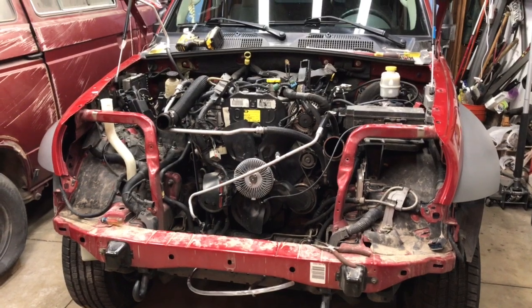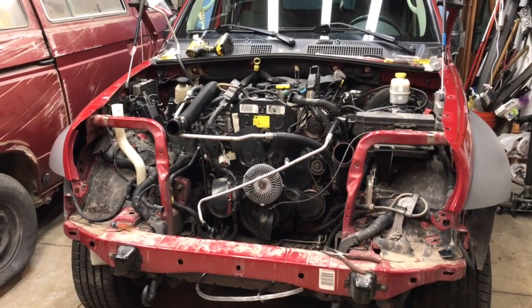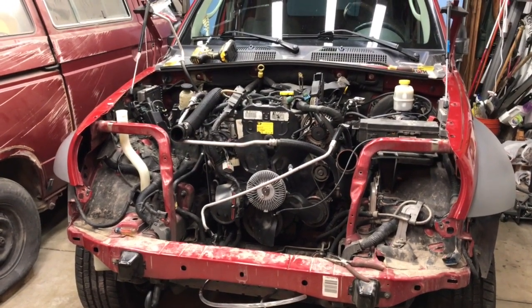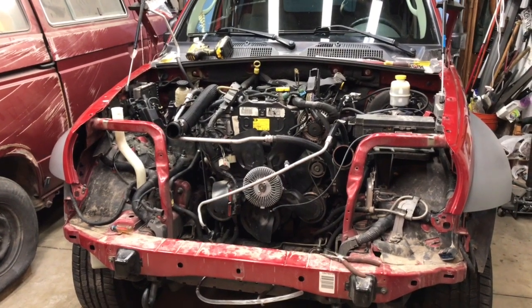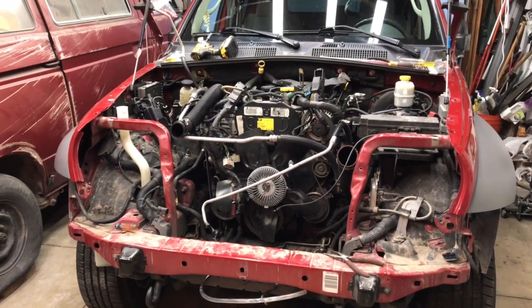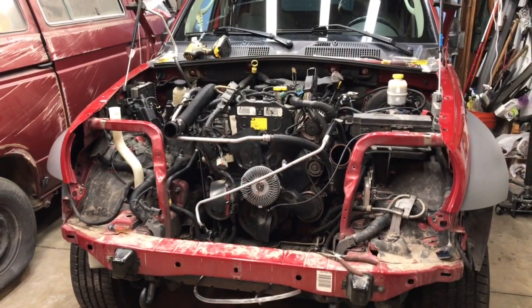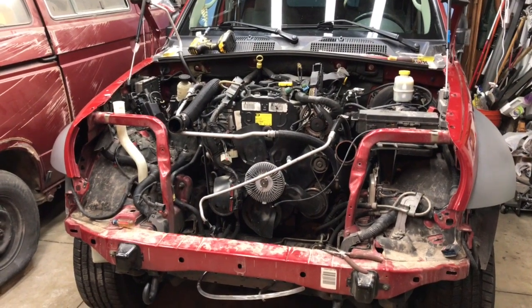And something happened. I wasn't driving it at the time. And it died. Wouldn't restart. And it made a thunk-thunk when you turned it over. So I'm going, okay, something internally is bad. A thunk-thunk's pretty bad. A pop-pop out the intake means bad rockers. A thump-thump means a bent valve or a dropped valve or something. So no matter what, things have to come apart.